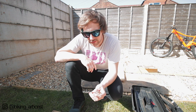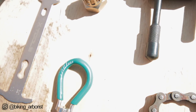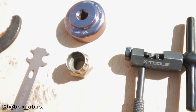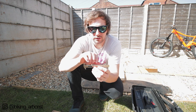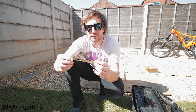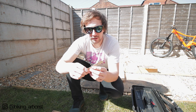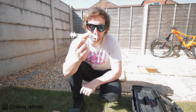Probably one of my most recent tools - I used to use a tape measure or a metal ruler, but this is a chain checker. I literally got this last week after Jared Graves put a post up on Instagram and I thought I need to get one of them - it's about three quid. You can basically check whether your chain is worn or ready for changing. Nine times out of ten you can tell when it needs changing anyway, but you want to change it before you start wearing out your cassette and chain ring.